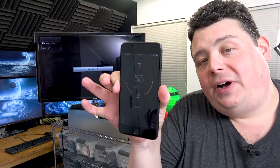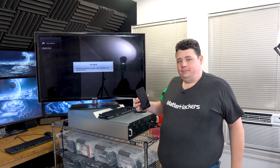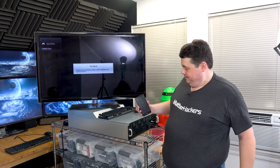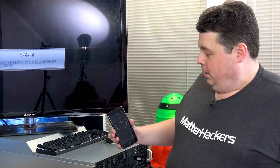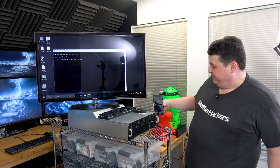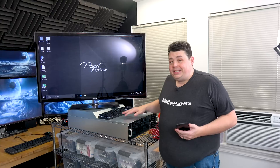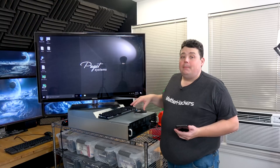She's all put back together. We went ahead and downloaded a decibel meter for the iPhone because I want you guys to see how truly loud this is. Right now the ambient noise in the room is 55 decibels. Let's go ahead and back up and fire this bad boy up. Right now we're showing 104, 104, 107 — you can clearly see it's 104. Now it will calm down. Once it posts video and gets posted, it'll get much quieter. Now we're sitting at 70. When I talk, the decibels come up, so it's not even as loud as me talking. We're at 75 decibels, but the system has potential for a massive amount of airflow — as it needs more because of heat inside, it's going to get much, much louder. At full trot, over a hundred decibels, it is loud.